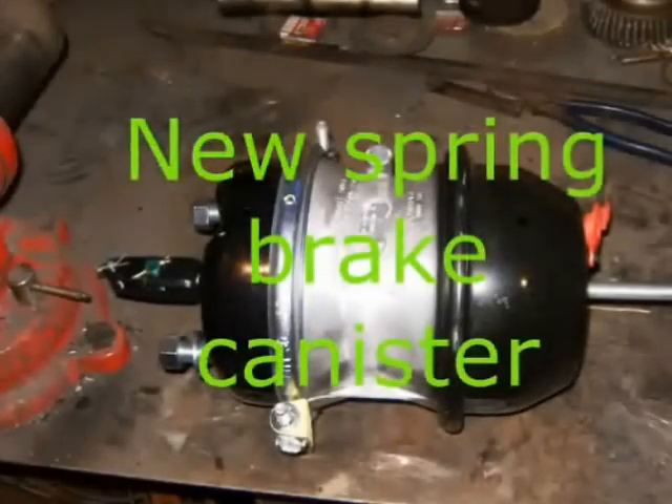The way it works is you stick it down in there. There's a square key and it fits down in there — you wiggle it around a little bit to get it to lock in that key, and then you tighten it down. You keep tightening it down and what it does is it cages the spring that's in this spring brake mechanism, pulling the arm all the way back and compressing the spring so you can work with it safely.